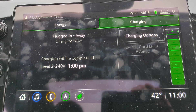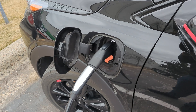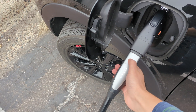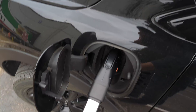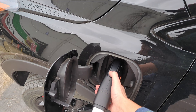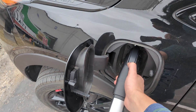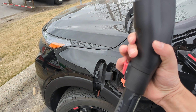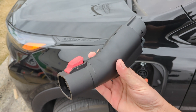We'll have a full battery by 1pm — about two hours to a full battery, currently at 80%. Now let's see how we disconnect this. We disconnect it with the Tesla button, but pressing the button on the Tesla connector, nothing happens. So you press it there, heard the contactor, and we're not currently pulling any power anymore — then simply lift out. Then it's a matter of pressing the red lever and pulling out the Tesla plug.